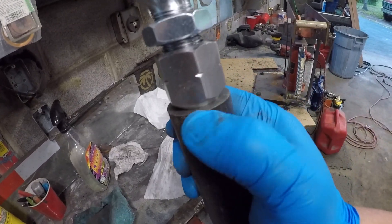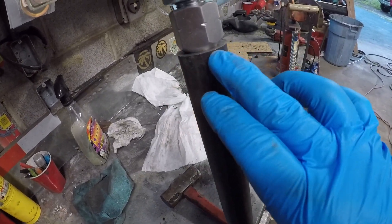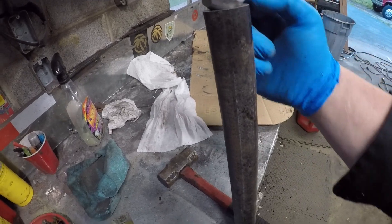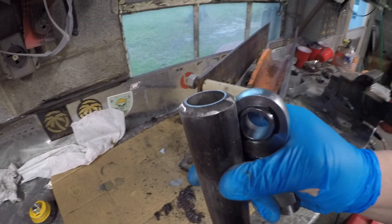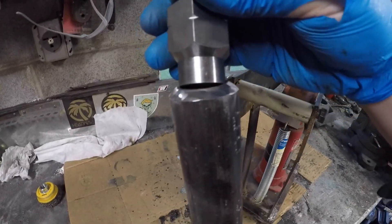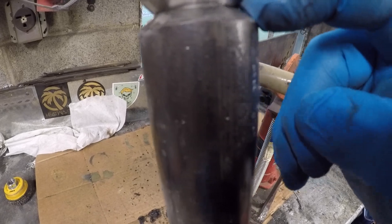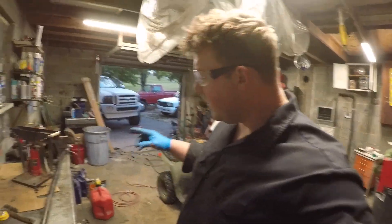I flush-welded this instead - I'll just bevel this down and then when this slides on, I'll just be able to weld and fill in the middle. Here is the beveled edge I just did, and when this sticks on there like that, you can see now I'll be able to make penetration all the way through. That's how I'm going to do this.